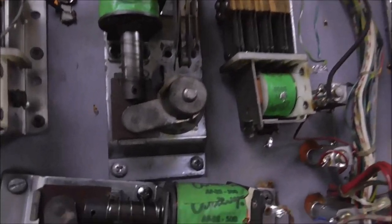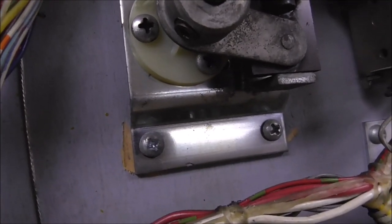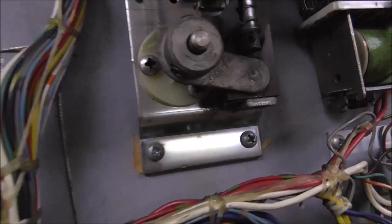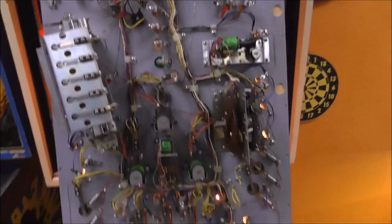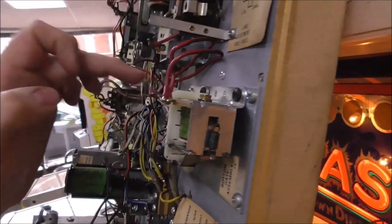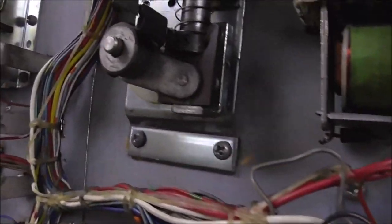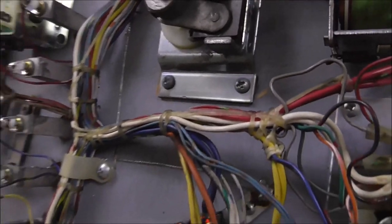Okay, so someone has replaced those, and if you look very carefully, see the mark on the playfield where it used to be, and then those screws look right, but look at this. See how that's the wrong screw? And sure enough, sure as you're born, see those two screws? Those two screw holes are right where those two screws are on that plate. So, almost like I've seen that before. They ran the screws. They used the wrong screw and ran it all the way through the playfield up into the artwork. What are you doing? People, don't do that. Don't do it.